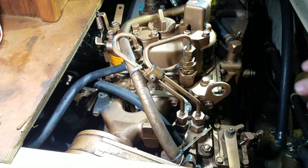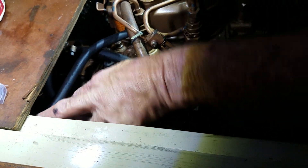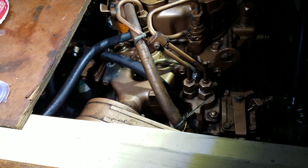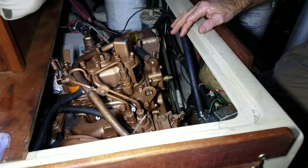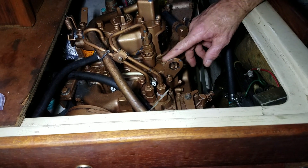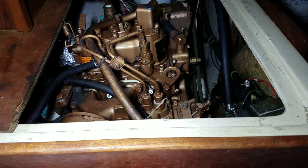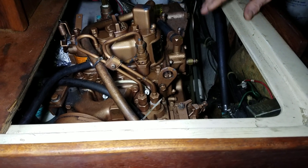Some of them go straight to the tank, which I prefer. Sometimes they plumb these back to the filter, which I don't like because you can get recirculating air. This one's return line goes to the tank. The flow on that line is minimal — there's hardly any fuel going through here, very little return. Some of the bigger diesels have a stream of fuel running on the return line, but at this size it's minuscule.